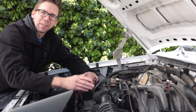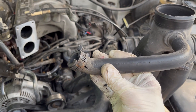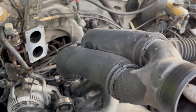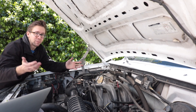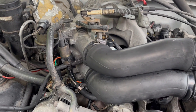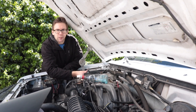During reassembly I had to figure out why these black tubes were covered with oil. This EVAP hose had exploded and basically covered everything in the vicinity with a nice film of oil — so be sure to check yours for a leak down there. Might have one, might not. And look at that — we did it, got her all back together, didn't catch on fire. Sounds 10,000 times better.